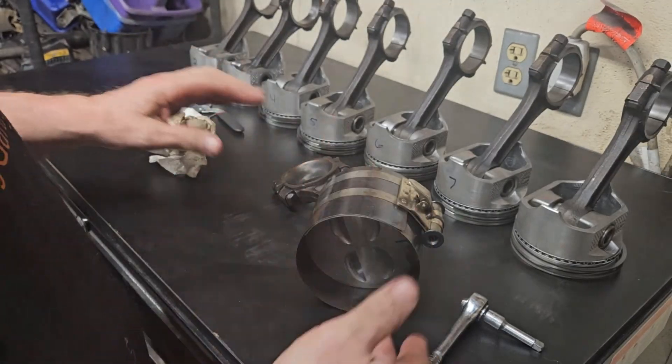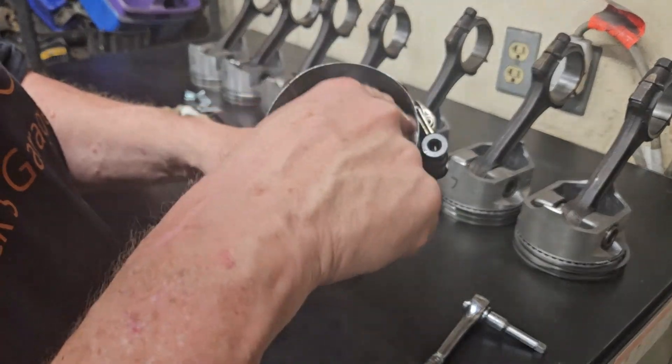When we actually do this, I'll show you we're going to put oil in here because we want to lubricate. Once we're ready we'll oil the cylinders and oil the rings. This is the messy part but it's the last thing to do - we'll put bearings in the saddles, oil the rings, oil the cylinders, slop everything up and start putting pistons in. That's the biggest thing, all the rest of it is just outside extra stuff.